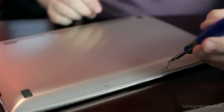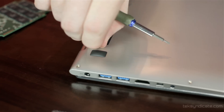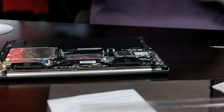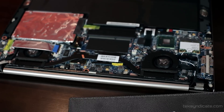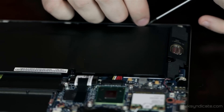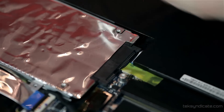To take the back off, you'll need a Torx screwdriver. Some screws on the back are at an angle, so hold the screwdriver at an angle so you don't damage the screw. Remove all screws — there are several around the back. You'll notice the back is sticky with some tape; just lift it off gently and remove the tape. There's the SODIMM slot — pull that out if you need to install a larger one, just like any other laptop. To remove the hard drive, there are four screws — two accessible easily, and two under the battery, so unscrew the screws around the battery. You may need tweezers to grab them.